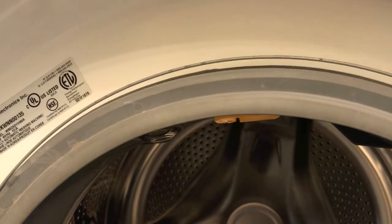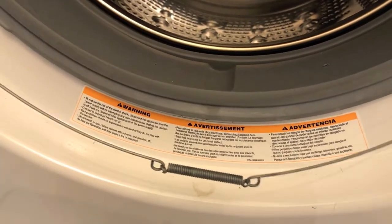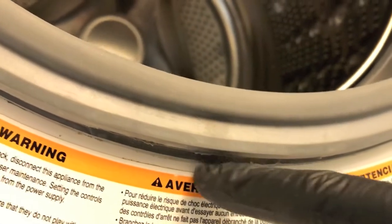The way you want to do this: put the actual locking ring into the groove. I want to point out the lower spring — make sure it's in the exact same position and spot that it was prior to taking it off. Something very important: this groove is where that spring goes, and again this is on the very bottom portion of the tub seal.